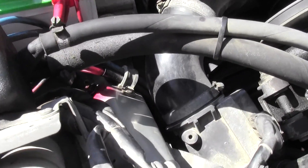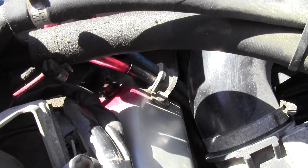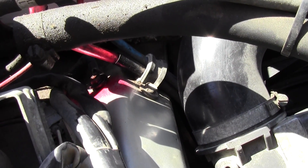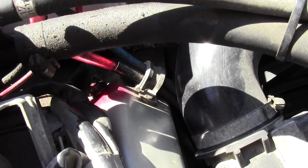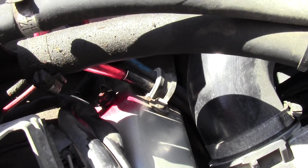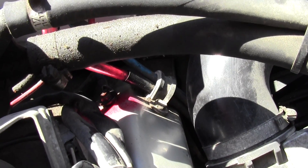I'm going to show the first one here — it comes right off of the battery, right off of where the negative cable comes out, and it goes into the fender. You can kind of see the bolt there. It's got some red anti-corrosion spray around it, but I think this was the one causing the problems, because when I disconnected the negative cable to clean it, I was probably jiggling this ground just enough to temporarily improve the connection. It was very dirty around this ground.